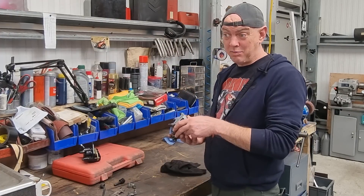All I've done is pump it full of WD-40, all the nipples are in, there's a bolt where the banjo goes to seal all that up, and I'm just squirting it down this side as well - trying to get something in the gap so I can do the socket trick and get it moving. Then hopefully I'll be able to get it out with compressed air. He needs to come out so I can paint the whole thing, and then I can rob the service kit off the broken one where the casting's broke where the nipple goes in. Stick it on this one and jobs are good.